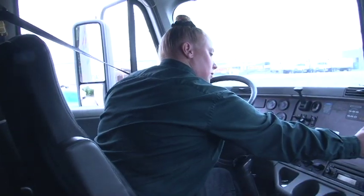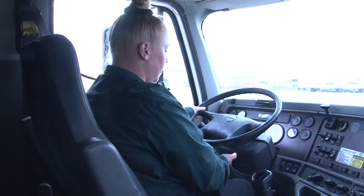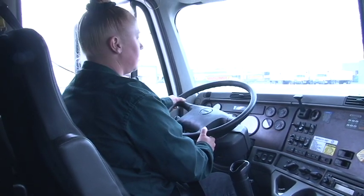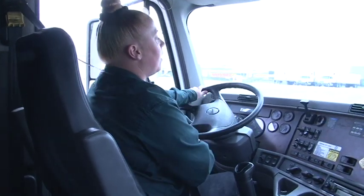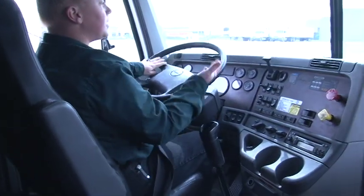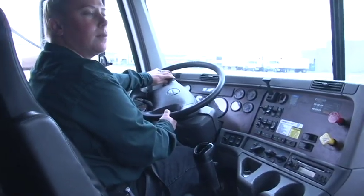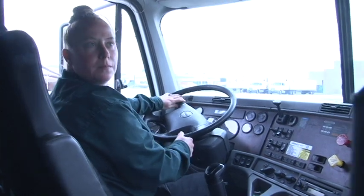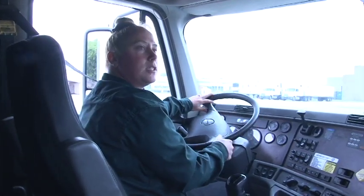Release the brakes. Check traffic. As you begin to engage the clutch, let go of the brake. Now as we're moving and pulling out — the same thing applies when backing up. If you apply the brakes first, feel what happens. What's happening? I feel a surge. You feel that surge of power — the truck thinks it's under a load and will actually speed up.